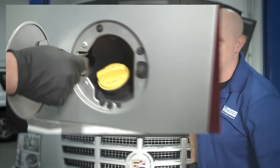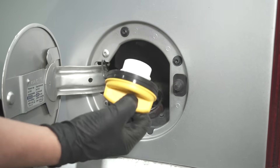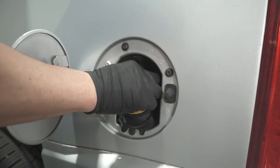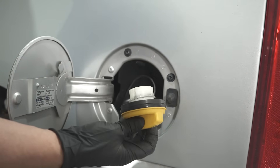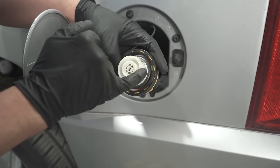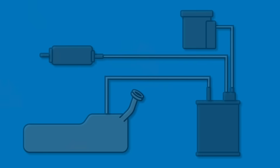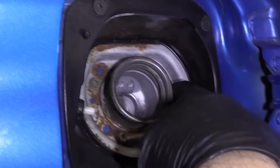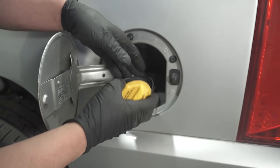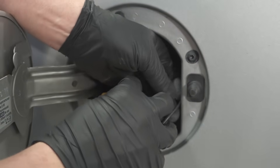Let's go check the gas cap. The first thing you want to do is just grab the gas cap and give it a shake. If it's loose, obviously you just got to tighten it up. Take it off and take a quick look to see if there's any cracking around that seal — sometimes you see some dry rot in there. On the filler neck itself, sometimes you'll see excessive rust buildup and that could cause some issues. Also, this wire or cable tie — if that gets in the way, it's not gonna seal properly.